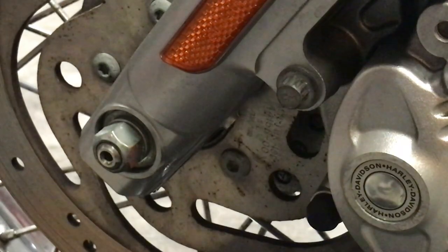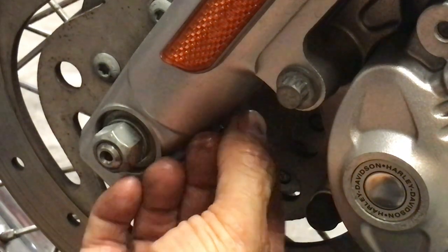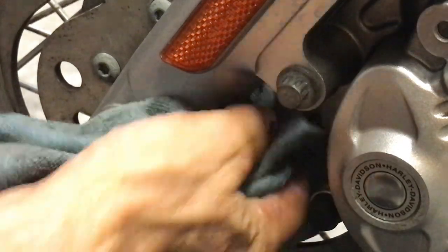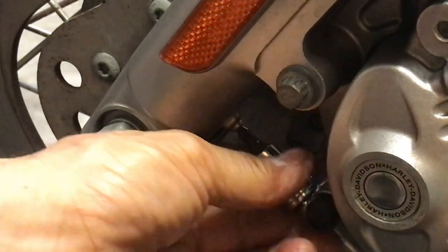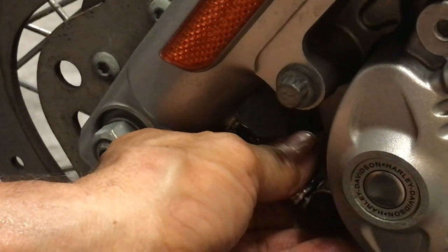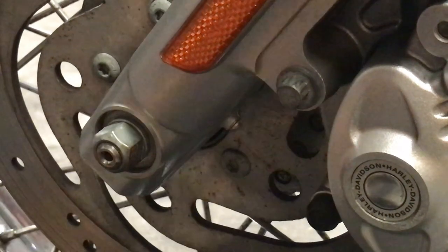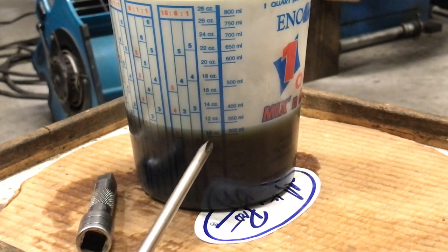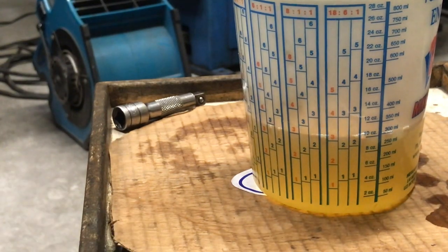Here's my little drain plug. I'm going to clean it with the wire brush and wipe it clean. Let's put this plug back in there. As you're threading it in, that thread sealer pushes back — it's not going to cause any havoc. There's a brass washer. Clean it up. 10 ounces, 15 weight fork oil — that's what I will replace. I've got 10 ounces, 15 weight fork oil, and I'm going to put that in now.